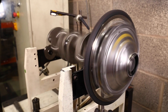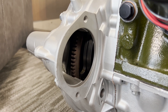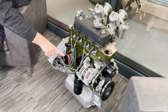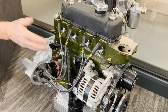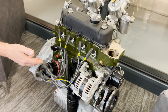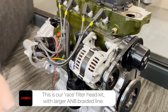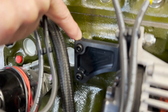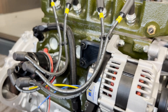The flywheel is one of our ST2 flywheels with the ultralight EN8 flywheel and ultralight EN8 back plate. It's got the bonded clutch plate in it - the rally type with an orange diaphragm - all fully balanced with the crankshaft. We've got an Aldon distributor to match the camshaft. We decided not to put the full oil cooler kit on this - it's only a fast road engine and it's not going to be used on the track at the moment; if it does we'll put the cooler kit on. But it's got the black braided hose kit down to the billet filter head. We've also fitted the MED alternator and a little aluminium billet alternator bracket we've developed, held on with Allen cap screws - just a nice little touch.